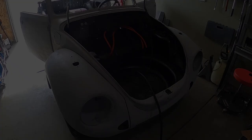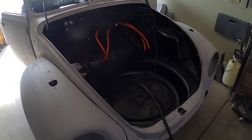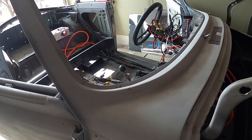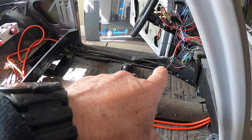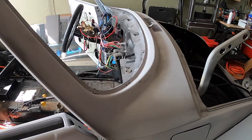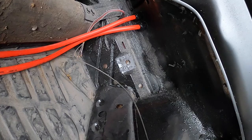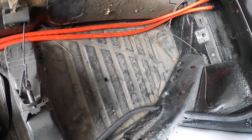Progress update: I've got the high voltage wires ready to go with connectors to clip onto the side of the battery pack. I tried to run the wires through the heating channel but it narrows down to about an inch to an inch and a half pipe going up through the A-pillar — not enough room for that thick cable. So I decided to bring it right into the toe area with some gland nuts, tuck it in tighter with clips, put abrasion-resistant covering over the wires, and bring it up inside that way.